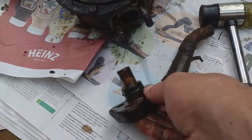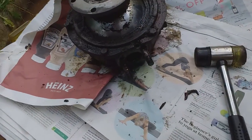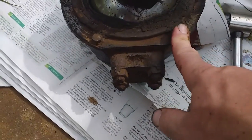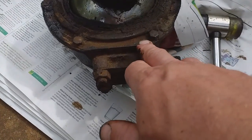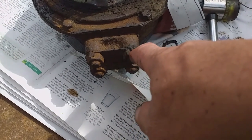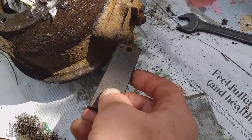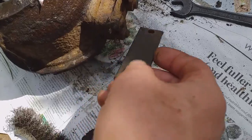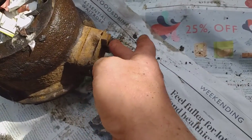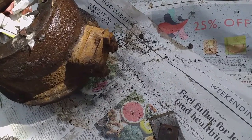There are no shims on this side - maybe not a 10-thou shim on this one. It's going to need a new O-ring and a clean-up, so we'll put that safe. Now turn this around and do the other side, then remove the swivel seal retaining plate. We've got to knock off another load of half lock tabs. I've knocked back all the lock tabs on these one-two-four-off bolts - they're seven-sixteenths BSF size. I'm going to heat these up with a blow torch first because they look pretty well stuck to the studs.